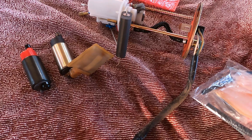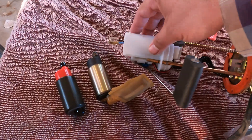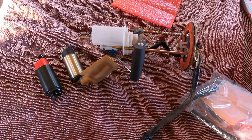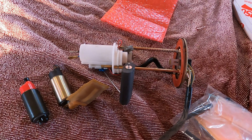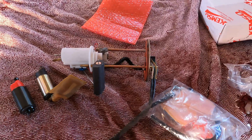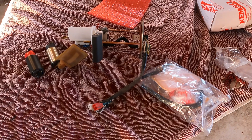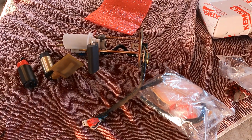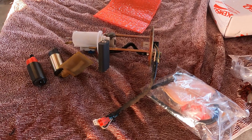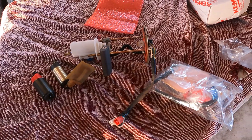What we're going to do is get this open, get the pump back up into its case carrier with the wires plugged in. We took some pictures so we don't mess that up, and then we'll go over to the four-wheeler and start putting this all back together. I had the fuel injector off earlier and it's spraying when it's pressured up, so we're hoping this is the solution. We're going to get to work on this and we'll catch you up once we're trying to put this back in the fuel tank on the other side.